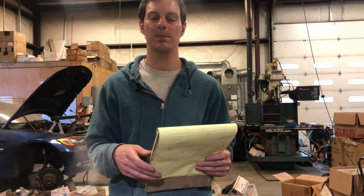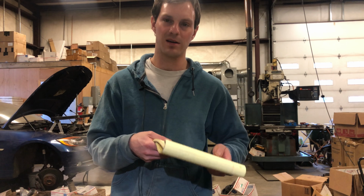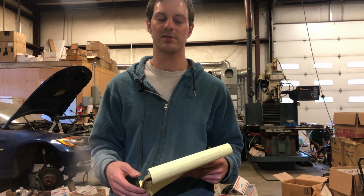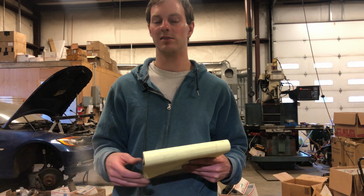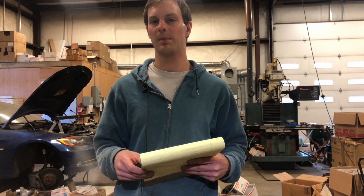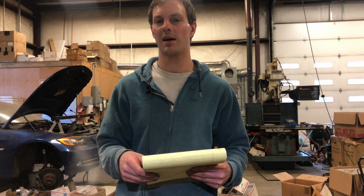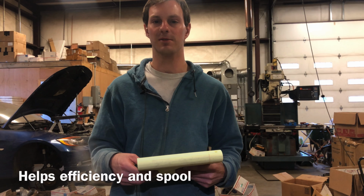But also, it can rip off the blades of the compressor wheel, but that's a really extreme case. It's rare that the surge actually does damage the turbo from what I've seen, but it's probably because I haven't built the turbo to excess on the compressor side in comparison to the exhaust side. So if that turbo didn't have anti-surge, usually you have a smaller compressor wheel than the turbine side, or they're about the same size. The best way to build a turbo is to have a compressor wheel and turbine wheel about the same size, because what you're truly aiming for is about the same flow rates on the compressor side and exhaust side, which helps to pick up efficiency.